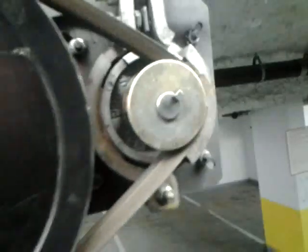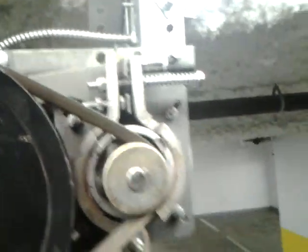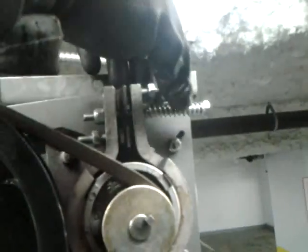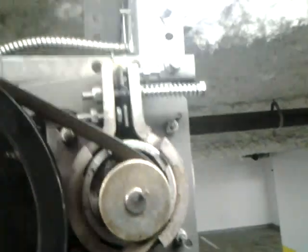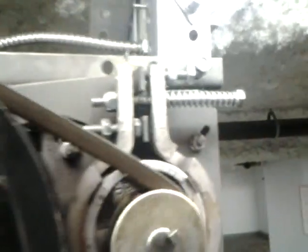Okay, now what you want to do, you want to move these to the equal pressure, and then the solenoid needs to be, I can't see it there, but about halfway in. So what I usually do is I set the solenoid about halfway in. How to do it with holding the camera. Basically move in this until it meets halfway on one screw. Keep bringing it in. No, a little bit more. Okay, that's about halfway in. And a tiny bit more. Okay, the top screw is done.